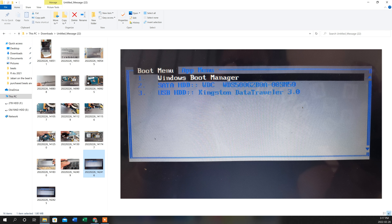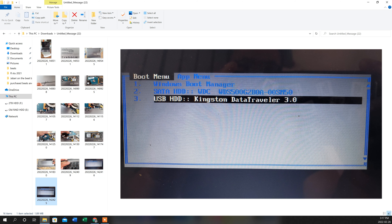Once you press F10, you'll see the USB flash drive with Windows 10 listed. By default it goes to the Windows Boot Manager, so use your up and down arrow keys to navigate to your USB drive. If you already know how to install Windows 10 the rest is straightforward, but I'll provide a link for step-by-step guidance. If you have any questions, write them in the comments and I'll reply as fast as I can. Thanks for watching!